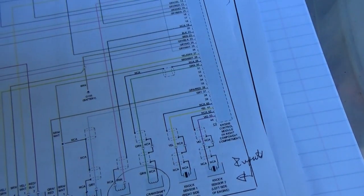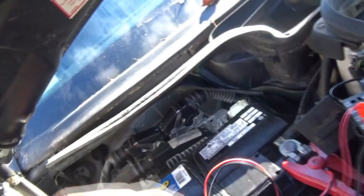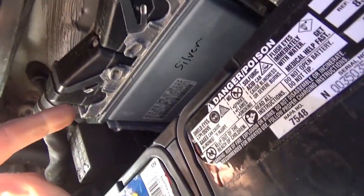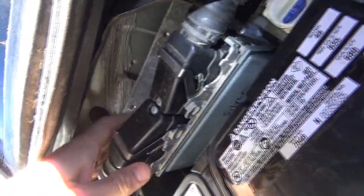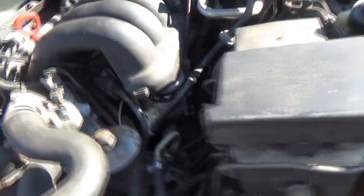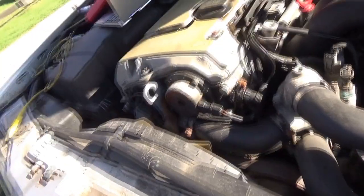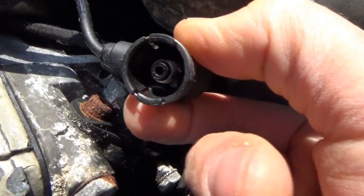Here's our engine controller right back here with two plugs. These are pretty easily movable. To get to the CKP sensor it's buried near the bell housing, and even if we can get to the sensor the connector is a shielded wire — almost like a BNC cable — so you can't really back-probe it. Easiest place to do this is at the computer, even though we have to take those connectors apart.